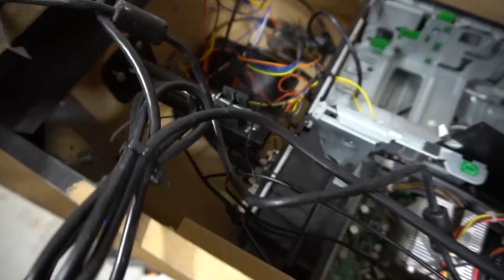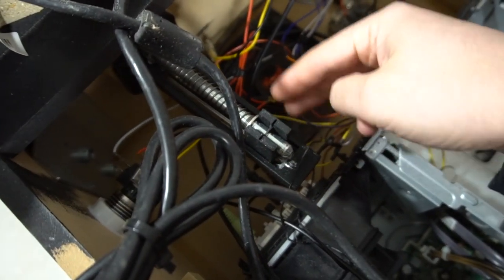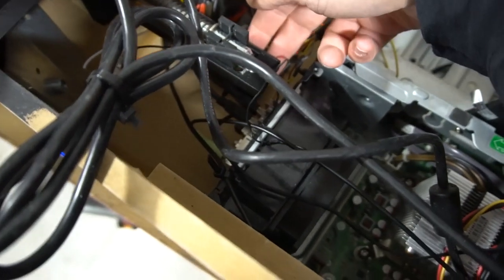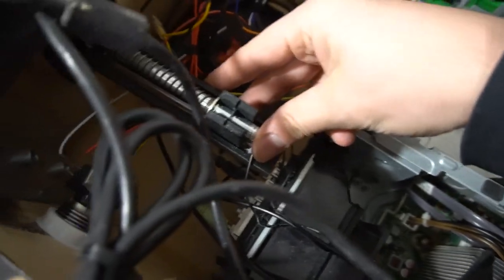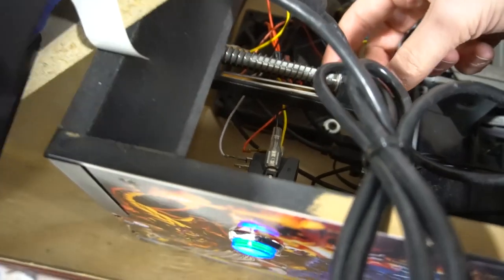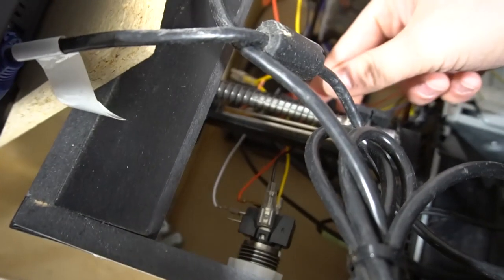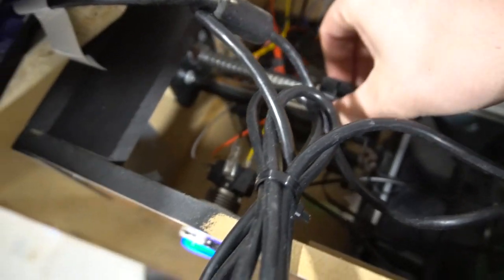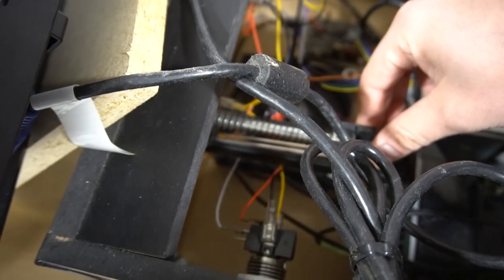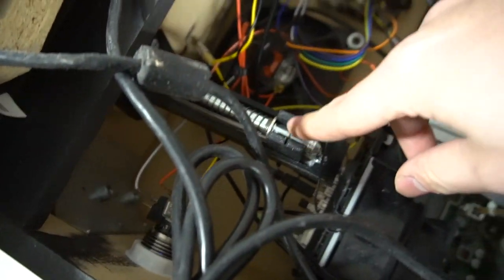Here real quick for the plunger, it looks like he's using one of those kits that somebody did a 3D print on, and it's basically wired up to the KLZ board. It does have a slider. Yes, it is a potentiometer. It's actually the same potentiometer that I have in my Vpin. I think it's called a Zebs kind of plunger kit. So there's your real analog plunger, which is probably a great feature out of this.